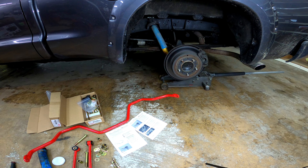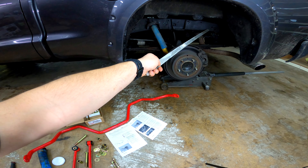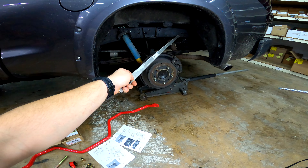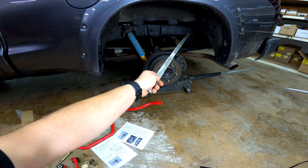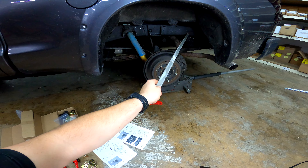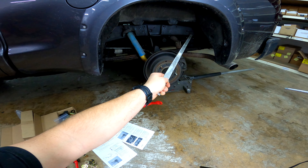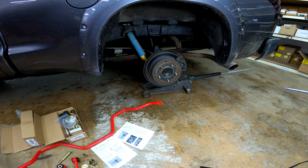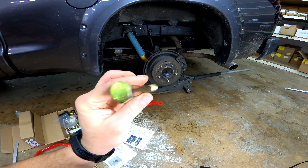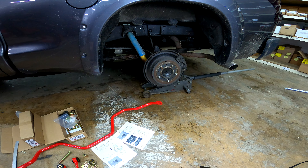So real simple — you either have a factory tow bar or you don't. If you follow the ruler here against the frame rail, there is a little hole here and a bolt that holds the rear tow assembly to the frame. Now if you don't have this, you still have the hole but you have to use a washer. But if you have the tow bar, this is your washer. Those holes — you're going to want to tap them out. They're M14 by 1.50. I had a really difficult time getting these out after 10 years. I'm surprised they didn't strip out or break, because it took quite a bit of force.